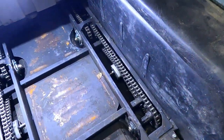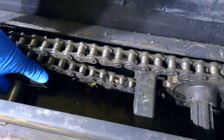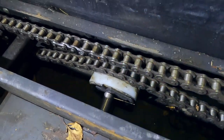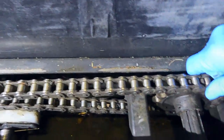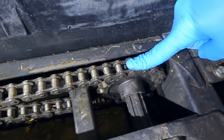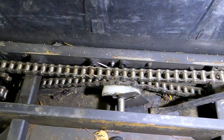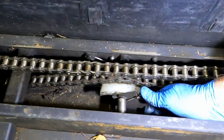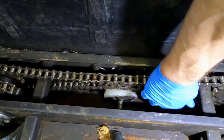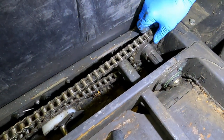Okay, this is the back of the machine. Looking at these chains, they don't look as dirty as I thought, but they're really tight right now. What I'm going to do is loosen the chain tightener — when I do that this chain will go slack, and then I can jiggle the back tire back and forth to see if there's any slop in the bearings. If there is, I'll replace that bearing. By rotating the tightener I can push it all the way down — now this chain is sloppy and there's no tension on it, so I can check these bearings.